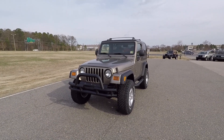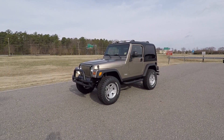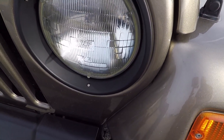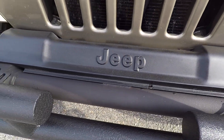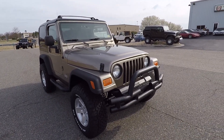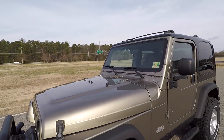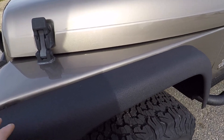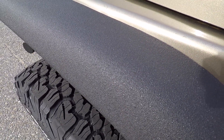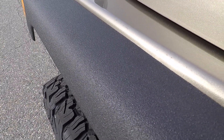There's a lot of stuff you could do if you bought this Jeep — you could add auxiliary lighting or a winch. The paint and body are in great shape, no damage, no issues. We blacked out the headlight bezels since there's really nothing else chrome on the Jeep. We removed the Jeep overlay and sprayed it black to keep it as clean as possible. The paint correction — wet sand, buff, and polish — is a two or three day service in itself. For the Kevlar package on the flares, we remove them, scuff and prep them, mix the Kevlar, and shoot a nice texture finish.